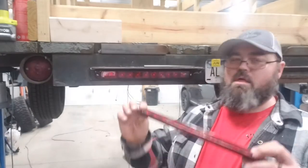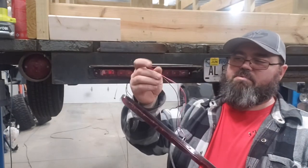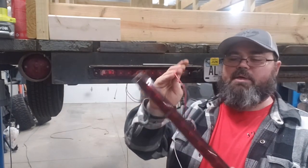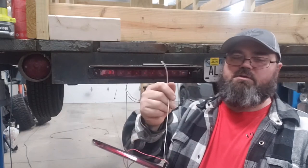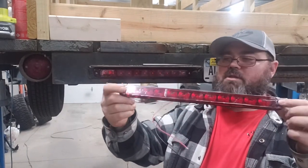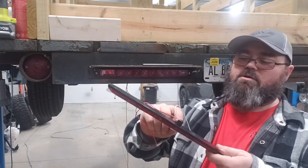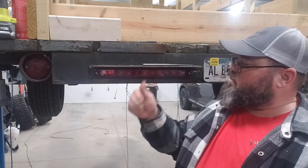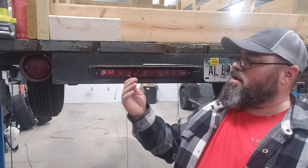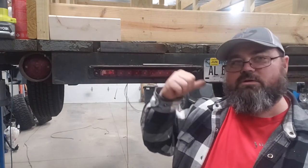Alright, as you can see, here's what we got for the LED strip we're gonna put across here. It does have brake and turn signal capability, so it does have a ground we need to get hooked up, and we're gonna hook that up right through one of the bolts that we put in to attach this to it. It does have a little bit of extra that I got to cut, or drill a hole through the center. You can see I got this one all mounted up, my wires are back here, and I just got to put in my stop and my turn signal, then get the other one installed on the other side.